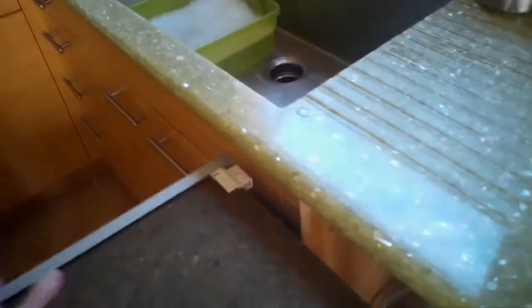The Miele typically gives you enough drain hose and intake hose where you don't have to disconnect them. You do want to turn off the power. So now I'm just going to lay it back on its side. I've already gotten all the water out of the sump by using a turkey baster just to suck out the water. So I'm going to lay it on the side. I did put a towel down because a little bit of water will still come out.